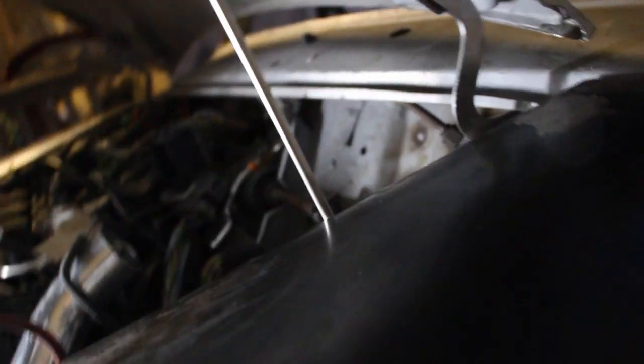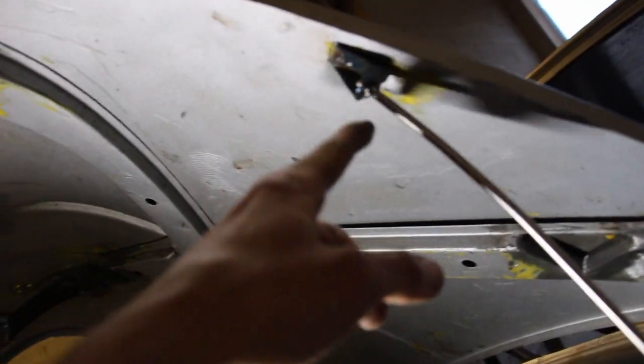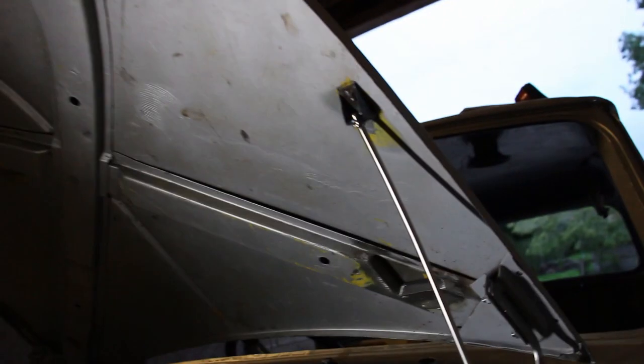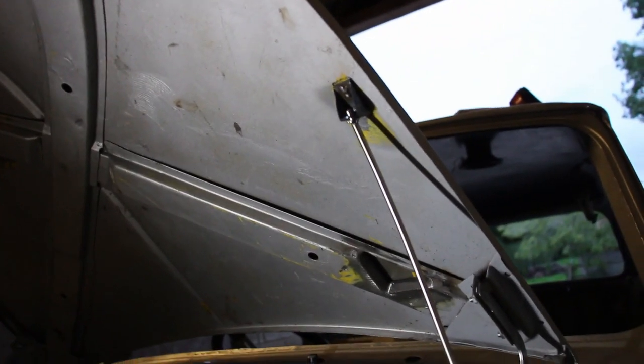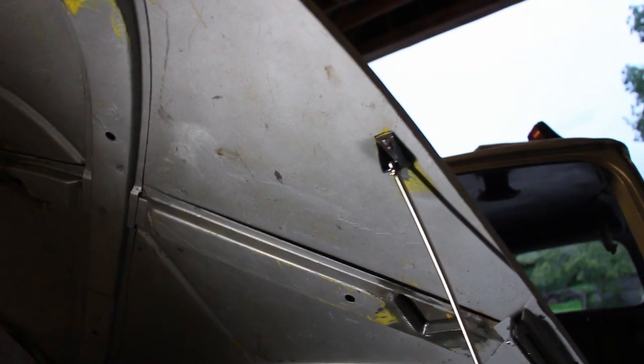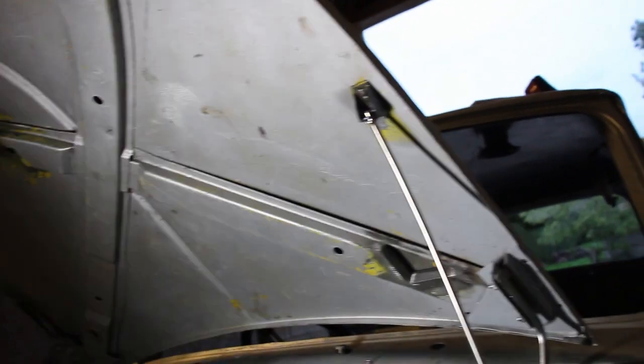and then a piece of stainless rod. We've shaped that S-bend on one end to obviously go through the hole, and you just saw the other end of that. And then it has a bit of shape to it for a couple of reasons. Well, one main reason is where it can sit afterwards. We've then got a little tab. I tried to TIG weld a little tiny washer on the end of it. It does work. Not nearly as tight as I wanted, but as soon as I got the puddle going, the washer was disappearing very quickly, so it does work okay, and it's a bonnet stay, isn't it?